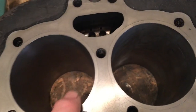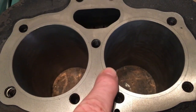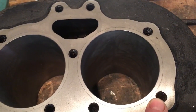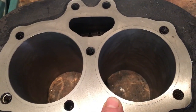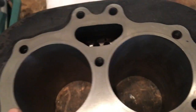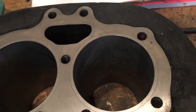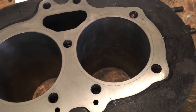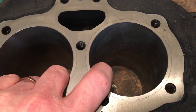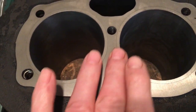You can just see the top flange of the liners — these are flanged, so that's obviously additional insurance to prevent them from slipping. They've also skimmed the top surface for the mating surface for the cylinder head. We did find it was a bit low on this side, so I'm glad we did that.